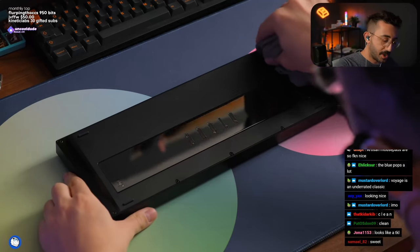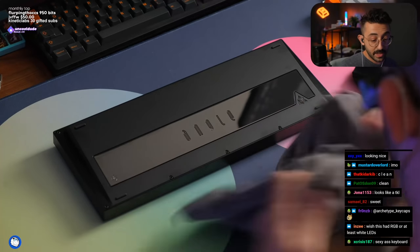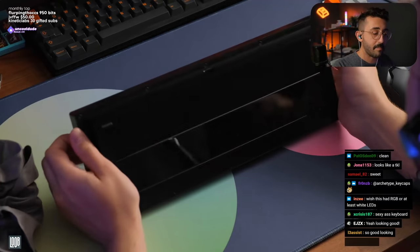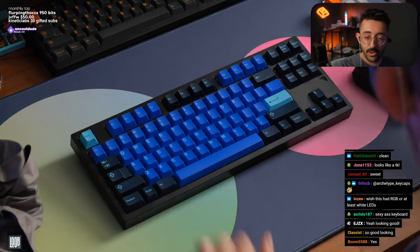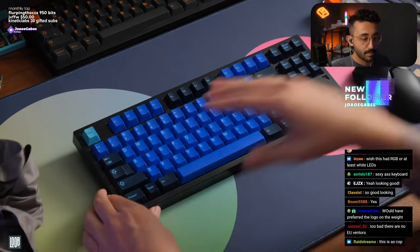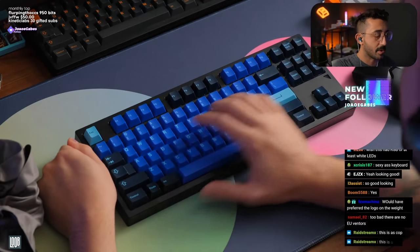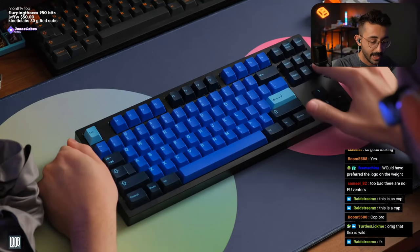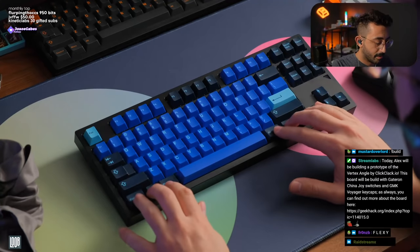So again, anode quality is pretty good. The build was interesting. I wouldn't say it was anything challenging. Internals are very pretty. I think even the exterior is very pretty. Interesting mounting with those curved places where the flex points are. You can really see the flex with this board, dude. Look at that. That's not me pressing, that's the actual keyboard. This is pretty flexy everywhere you press. It has a very consistent flex. And this is an aluminum plate too.